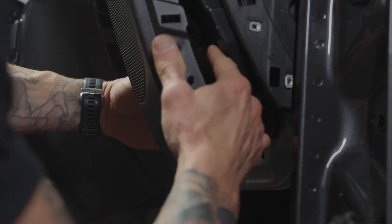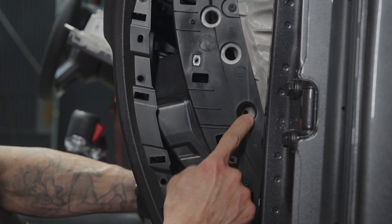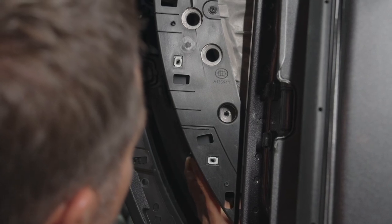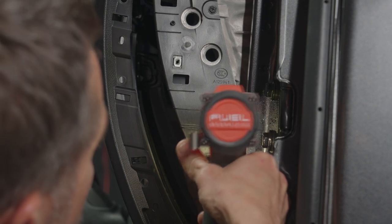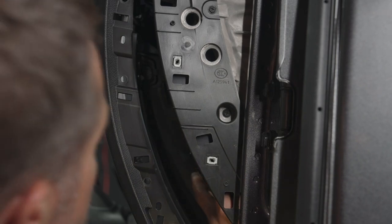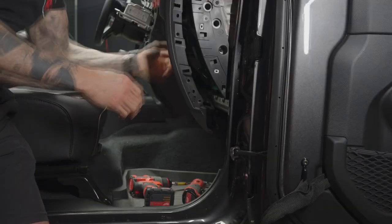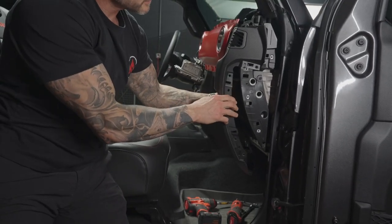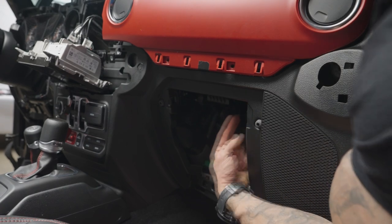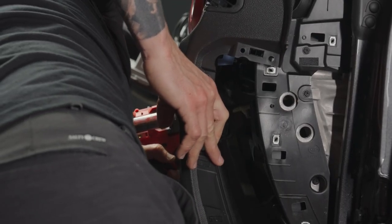Rest the pod against the front — as long as the speaker isn't poking into anything there's plenty of room. Install the side screw: shine some light inside, line up the hole, and screw it in. Then go back and finish screwing in the bottom screw. Now screw in the top screw of the pod that's up inside the dash — this is the one on the top right side inside the glove box.